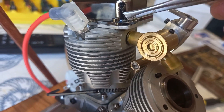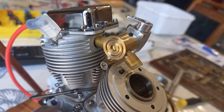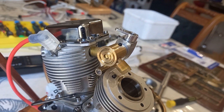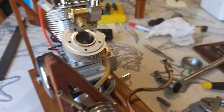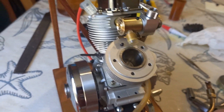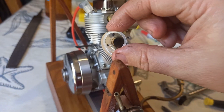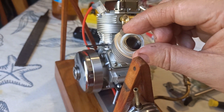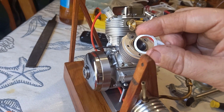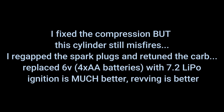I'm applying it around where the carburetor is a press fit into both cylinder heads, to ensure there's no leaking. I'll also neaten up this area and use sealant to help stop things unscrewing themselves. As for the head gasket — I believe it's aluminum, nice and soft — I'll put a little smear of sealant on that too. It doesn't get very hot, so that's all fine. It's going to be better, stronger, faster, and cleaner.